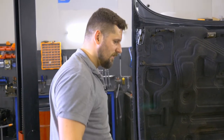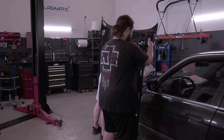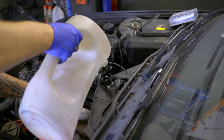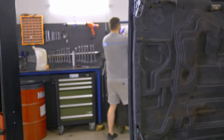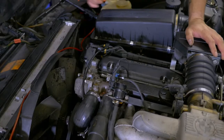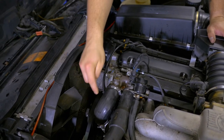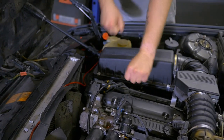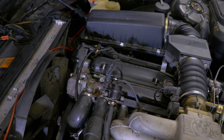That was easy — move. Almost, almost, thirsty. Okay, so in order to replace that, remember to unplug this coolant hose from the thermostat housing and the lower hose so you can remove the sensor. To remove the sensor you just unplug it by pulling it off, then you pull off the sensor from here. From here it's going there — easy. Let's see how it works.